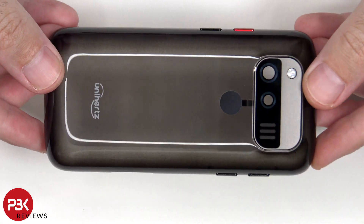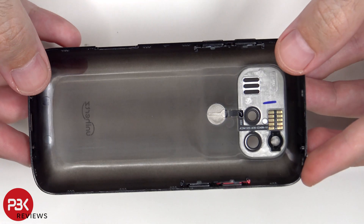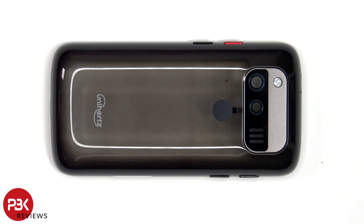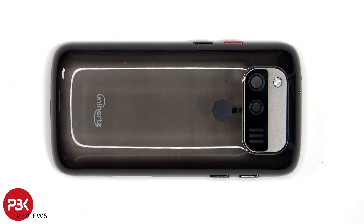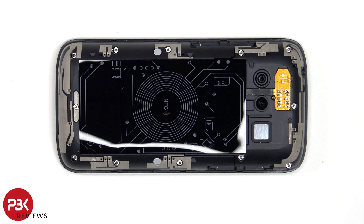Here's a look at the back plastic cover. The flex cable for the fingerprint sensor is located over here. The camera lens cover is held on with adhesive, so to replace that just apply some heat and pry it off. The plastic overlay resembling circuitry can be peeled off.